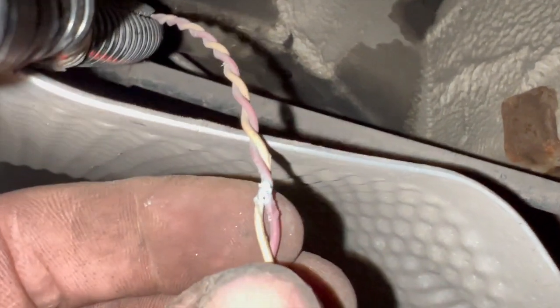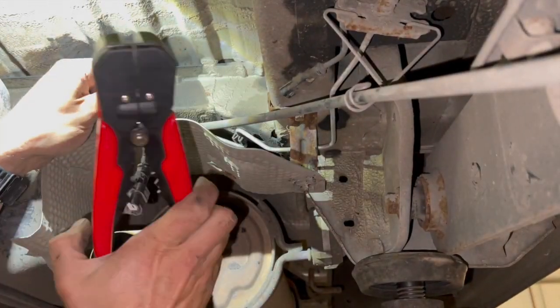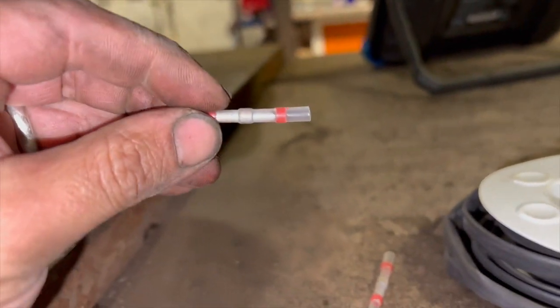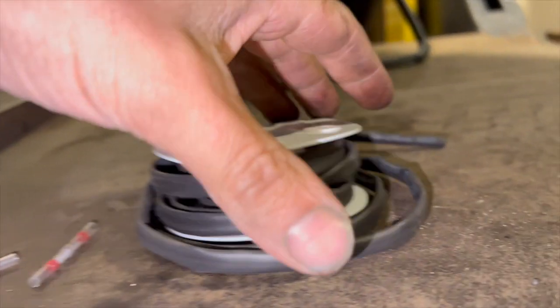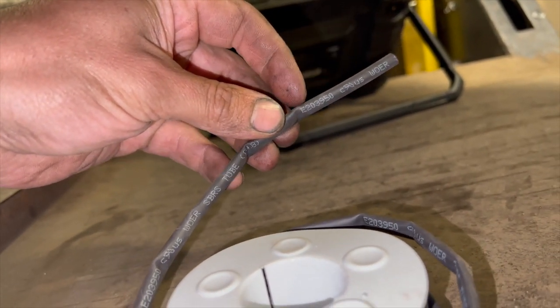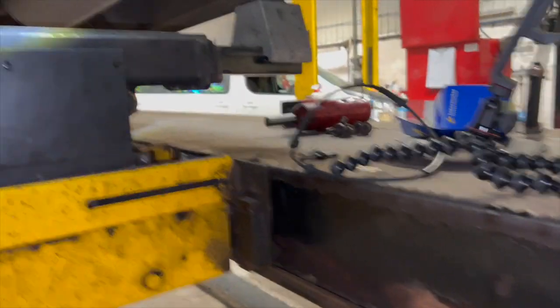Now I've got that stripped back — you can see it's completely rotted through on that reddish-purple coloured wire. We'll untwine these and use some heat-shrink solder connectors to repair them. I really like using these — they make a really nice neat job: the solder melts to form the joint, and two little bands seal it up on the wire as well. I'll put a link to them in the description. We've also got some glue-lined heat-shrink loom — we'll sleeve that over first, then once done push it over the top, heat it up, and it'll shrink down and seal it as well, giving a really solid repair. Then we'll go back to the scanner and hopefully it's fixed the fault.